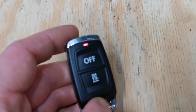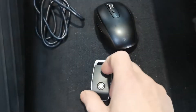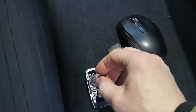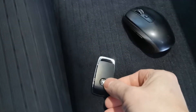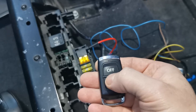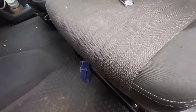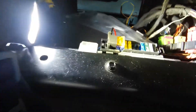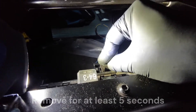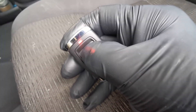Here you can see that the remote is telling me the battery is low and the remote wasn't able to connect to the receiver. Let's quickly change the CR2032 battery — the remote is quite sensitive to small voltage drops, but these batteries are easy to obtain and IKEA sells them for cheap. Battery is now fine but the steady blinking means the remote is not yet paired to the receiver. To pair: remove the receiver fuse for at least 5 seconds and then put it back in. After 2 seconds press and hold the off button until the red signal turns off — you can pair up to 5 remote controls to 1 receiver.